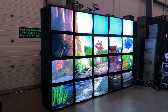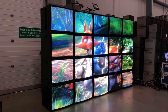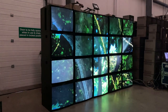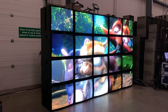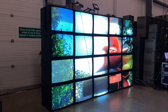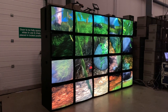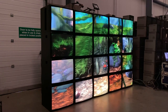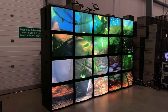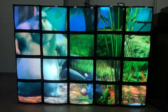You can just about see to the right there the playback units — we've got 20 processors running, feeding video to each of these screens, because each screen has to take its own video feed. The rack on the right-hand side, with the laptop on top, is processing all that, and there are 20 video feeds going out through those wires at the bottom. A lot of people assume you can just feed it with one signal and it daisy-chains across to all the screens as you would with modern screens, but that is not the case with old CRT screens. Overscan is another issue — making sure the overscan is set correctly so the picture shows properly and all the images join up.